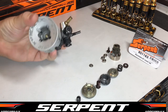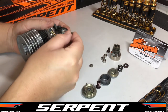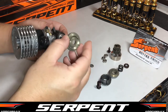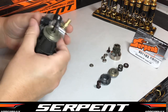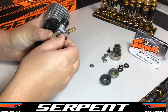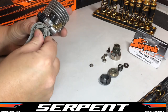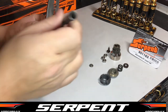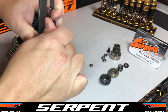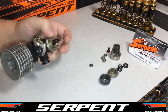So I've got my Max Power 21 GTR motor here. First step: the collet slides over nicely. Grab your flywheel and flywheel nut, screw that down. This is where you want to get your flywheel holding tool — slide straight over there, 10mm socket. This part we want to really crank down on with a lot of force. No need to Loctite that one as it's on a taper so it's going to self-lock.